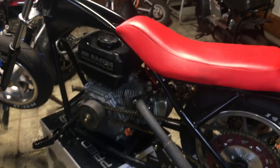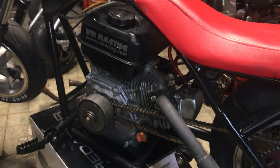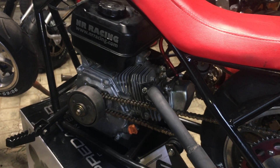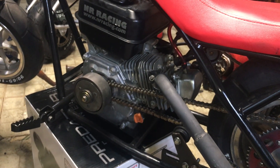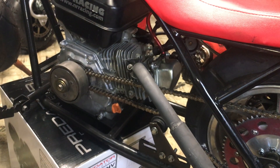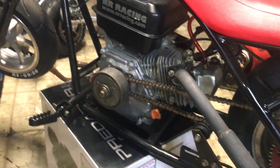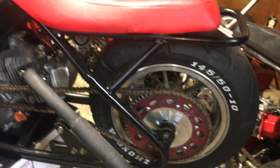So this is the motor build. It's a stock bore, stock stroke, non-hemi motor. Wiseco flat top, billet rod, billet flywheel, stock timing at 32 degrees, 26-pound springs, ported head, stock valves, 308 cam, 12/64 gearing with a 16.5-inch tire, eBay pipe, and the rest I made at home.